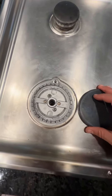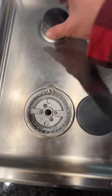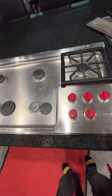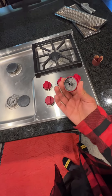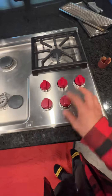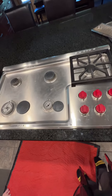If that didn't fix the problem, you'll need to open the screws from the center of the burner — not these two, but these two — one from each burner. Of course, unplug the unit first, and the whole burner top comes out. You also disconnect the wiring — just pull it out — and keep the top on a blanket on the side.